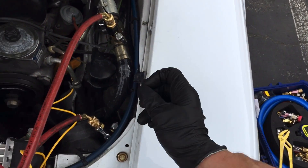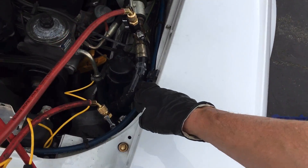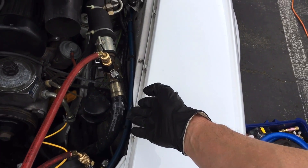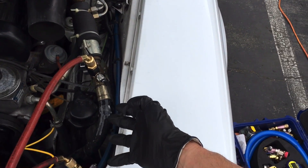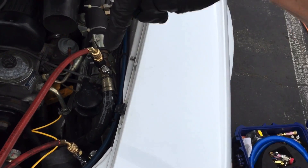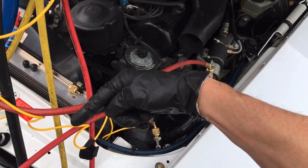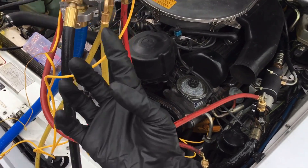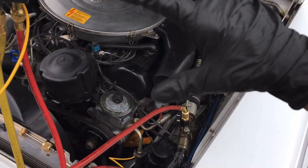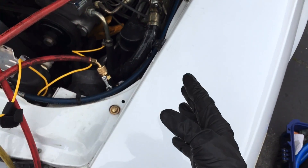That's a hard one to find because it only happens when it's running and only a little bit — no oil or dye comes up through the outer layer. Some hoses are two layers on really old stuff, and some are three layers on the later stuff once you got into R134 and barrier hoses. So it has to travel through barriers — it could leak in one spot, travel a foot down the hose under one layer, and come out in another area through the micro holes that are every inch or so on the sheathing of the outer protective layer.